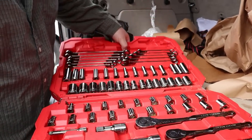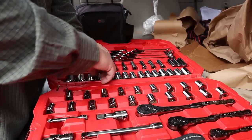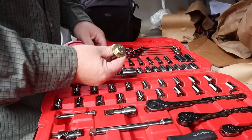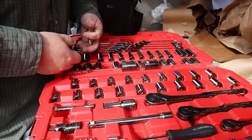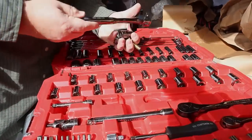Use our tool set here and one of the bolts included with the kit to find out what size socket we need. Let's try a three-quarter. That rarely happens, but three-quarter inch is the size of these bolts. Let me double-check the metric equivalent, which I think is 19 millimeter. That also fits. So I'll take both in case I need both. This vehicle hitch should just bolt right into place with six bolts included. We're lucking out — not all vehicles are like that, but we'll take what we can get.